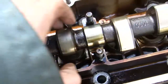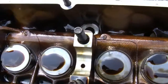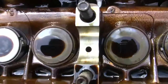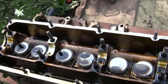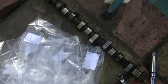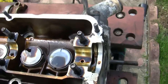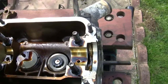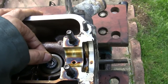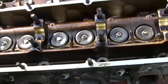You can see the running surfaces on the camshaft itself and also on the head itself — wipe the oil off — that's very, very tidy. Before we do anything else, you have to remember that all these eight belong to each other; they've all worn in together and they all match this head. So I've got eight bags here, numbered one to eight. These just pull out, and that piece of rubber as well — that is always worth changing because it helps to minimise your valve clatter. In fact, I'm surprised we can still see that after 100,000 miles. So that's all off now and we can see the tops of the valves are exposed.